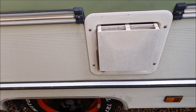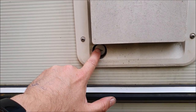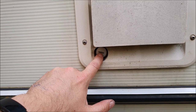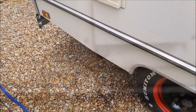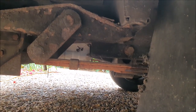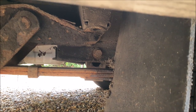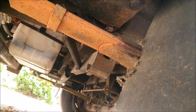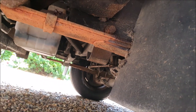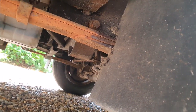This is the outside of the water heater, and if you're leaving the van in the winter months where it might freeze, you need to drain it off using this drain plug - just undo that, let it drain out, and put that back in again. The other thing you might want to do when you arrive on a campsite is underneath the van there is a jack lowering screw. There is the side leg and you can lower them onto wooden blocks to give yourself some extra stability if you are on site for a while.